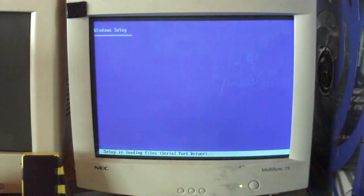But anyway, we're going to end up fixing the NTLDR thingy. Now, I think my theory is that the jumper settings are wrong in the computer because the BIOS was complaining before, the customer said, that there was no slave. And this was in a master jumper position instead of a slave position. And now it's saying that the NTLDR thing is missing, which is the boot thing for Windows. So what we're going to do is fix boot and fix master boot record, and we're going to do some things. And I'm going to show you how to do three things in here, whether they're necessary or not. That way you guys can fix anything with Windows insanity.